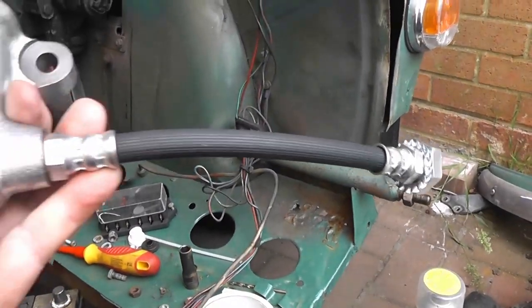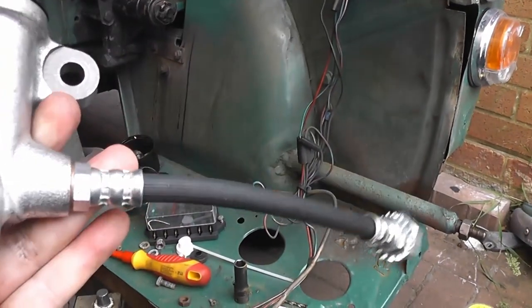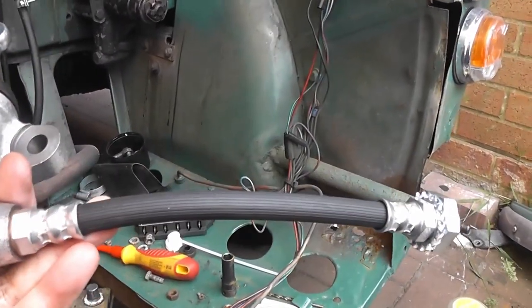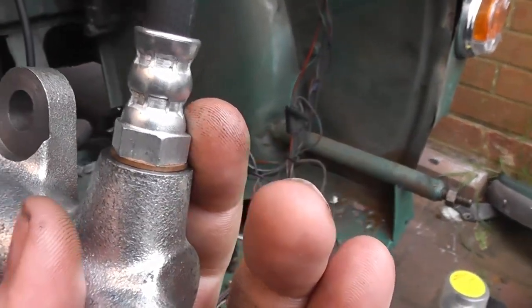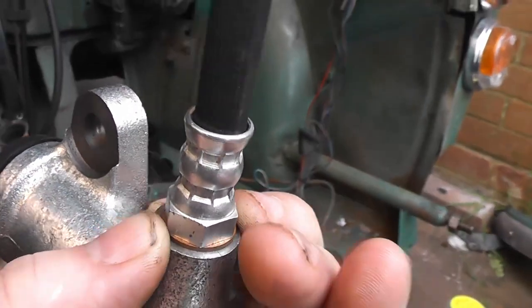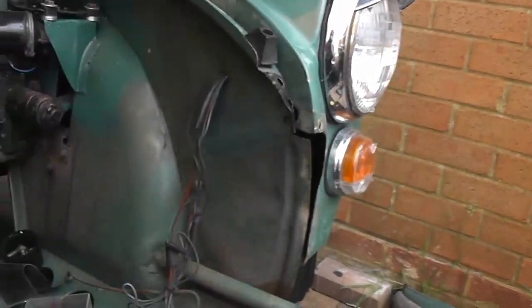And then you're going to need the clutch hose from a Mini, a pre-Verto Mini. So I think that's most Minis, like before 1989. Anyway, you'll need a clutch hose from one of those, and that will fit in perfectly into the slave cylinder with the copper washer as well. And then you will also obviously need the securing nut for the top of the clutch hose.